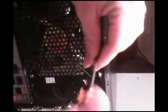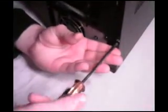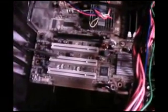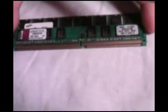A couple words of caution in regards to PC repair. First, ensure the computer is unplugged. Secondly, make flesh contact with the computer's metal chassis or frame every once in a while. This will ground out high voltage static electricity that may have been built up in your body. Static electricity can easily exceed 5,000 volts, which can damage the microscopic transistors within the computer circuitry. Because of this, it is important that you grab all circuit boards and cards on the sides, minimizing your contact with any metal part on the circuit.